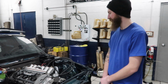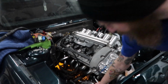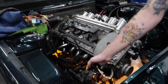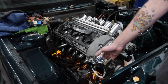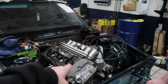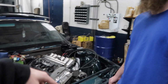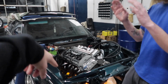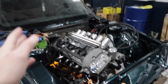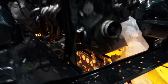Of course. As far as putting the engine in the car, I used the E34 specific engine mount brackets, so stock arms. The block is drilled where you can locate them farther forward than they sit in an E36 or E46 chassis, where the oil pan sump is in the front instead of the back, like this one. Basically M50s and all the M5X blocks have holes for both E34 and E36 mounts. Six bolts. Yeah, and so does an S54. So it's the same as the M50s. S50, M50, M52, all of those. So they can all go in an E34 with just swapping the arms, the dipstick tube and the oil pan, and then you need obviously the front sump.